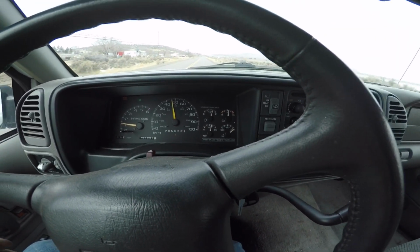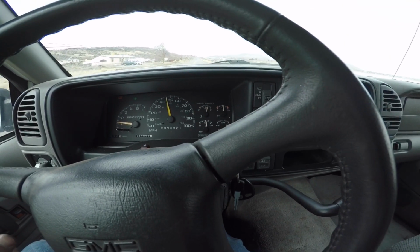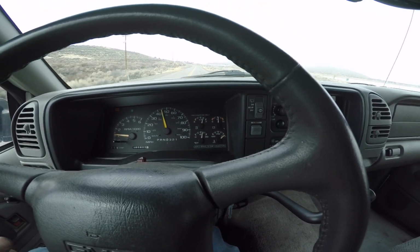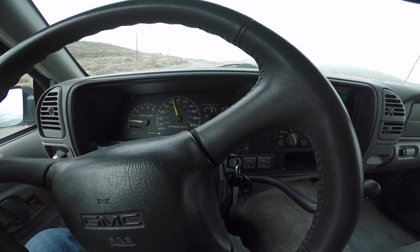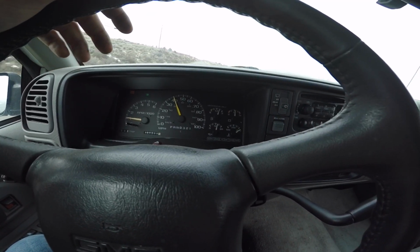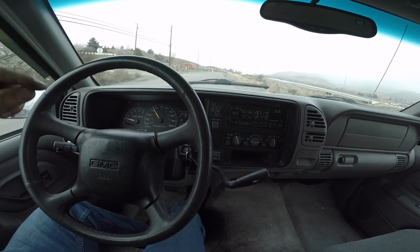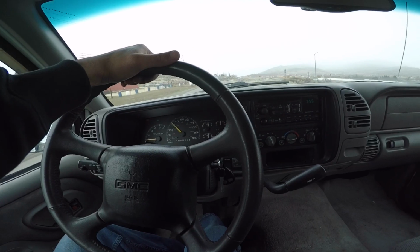Temp gauge, like I said, I think I'll go over that in a different video. My previous one, I used the LS1 3-wire. It reads about 10 or 15 degrees cool, but at least it works. You have the wire for the alternator, factory plug. Fuel gauge, you can have a person tune it in person. The output for the gauge is kind of hard to guess, so I just went ahead and bought the fuel link. I think it's the SN34 or something like that, and you can program it yourself so that it works. And that's pretty much it. And cruise control is the factory 99 cruise control that came out of this truck. You just need the cable out of the 99 through 02 trucks, and then you are set.